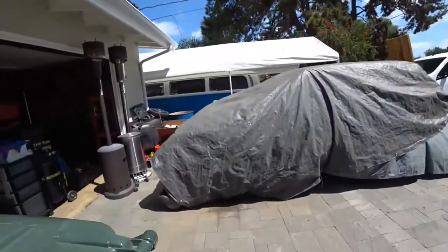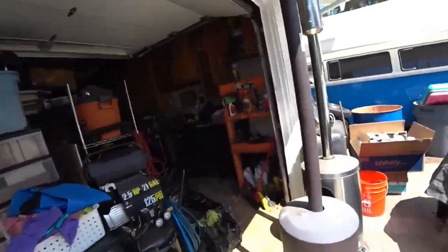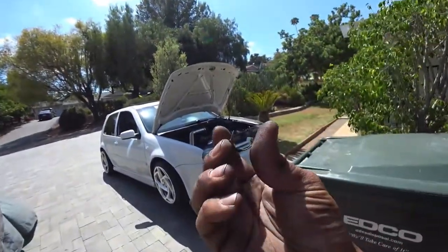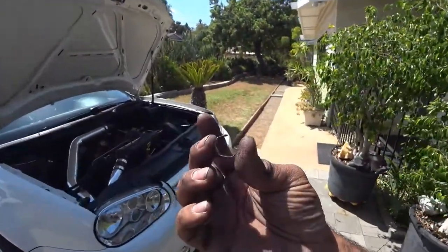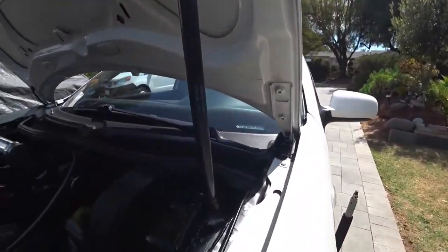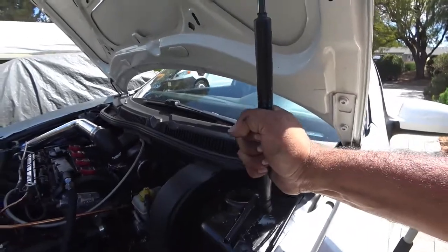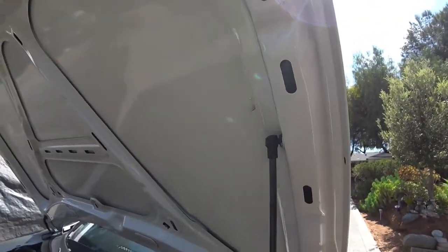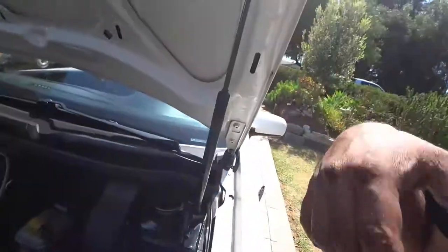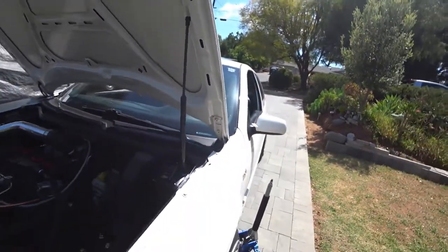So what actually ended up turning out to be — should have been a two-minute job, seriously — ended up being a five-minute quickie. So this was the issue: this little clip right here, you'll notice it's bowed out too much. It should have been compressed even more. So I just used an old one from the other shock, popped it in nice and secure, same up here, nice and secure. Easy trick: pull it off, pull it off, swap out the other one. Easy. Thanks for watching. This is a Pinchy Owl Quickie — peace out.